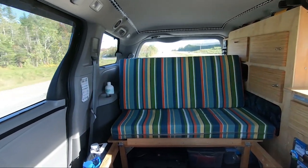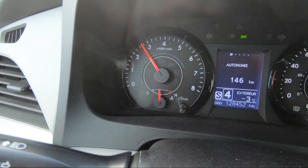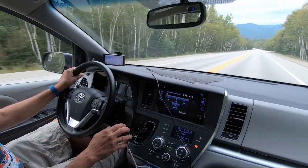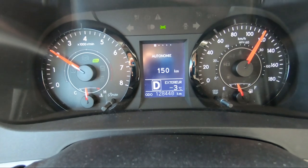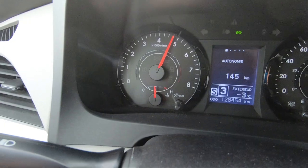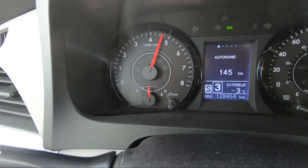It is the RPM. Just in case, what does the acronym RPM mean? RPM stands for revolutions per minute, which is the number of rotations the engine is doing in a minute. When engine braking, I take care to always stay above the usual minimum RPM used in the drive position. Otherwise, the engine will work too hard. I always keep my engine rotating lower than the maximum limit indicated on my RPM indicator. I even stay at least 2000 RPM lower than that maximum. As a general rule, going to the limits is never too good.